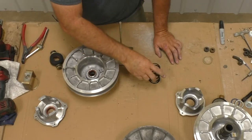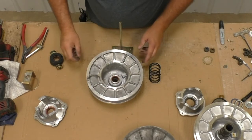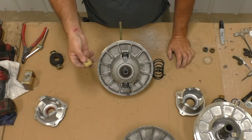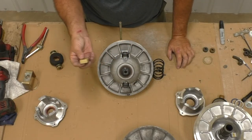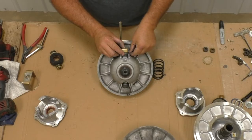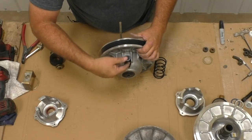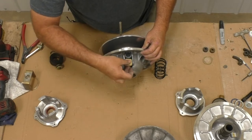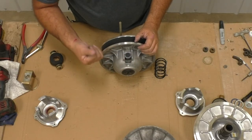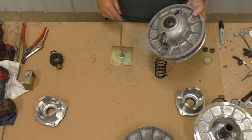Check the roller spring — is it broken? What condition are the bushings in? This bushing here is split — check what condition it's in. Flipping it over to the overhead view — if you still have the square pucks in it, you want to check this side. From the top angle, is there a groove where it slides back and forth? That is the side that will have the problem. A little bit of wear is okay — you can smooth it up and put our round rollers in.